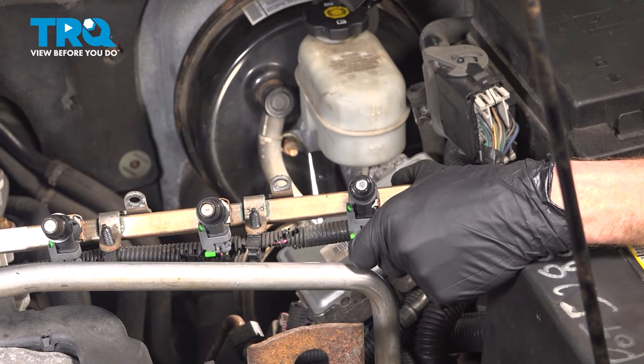Now we can put on our upper plastic plenum. This area will go up against the throttle body, sliding this over — but as we bring it down, we also want to pay attention to our breather hose, which slides down on top of the valve cover. Double check to make sure the breather hose is secure before continuing, as you may have to lift it back up. Press it onto the throttle body as far as possible, paying attention to the breather hose — we don't want a leak here. Time for the air inlet. Now we need to tighten each of our two clamps — one on each side of this plastic plenum. Take it only a little bit further once it feels like it's bottomed out; you do not want to strip this out. If it feels like it jumps one tooth, you have to replace the clamp. Give it a wiggle.